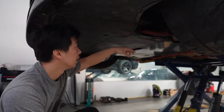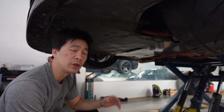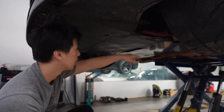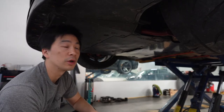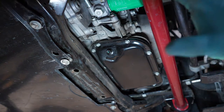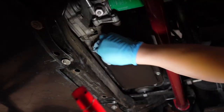Next step I do is change the oil. To do that for the GTR you have to remove the under tray — and I think most modern vehicles have an under tray you have to remove. There's a whole bunch of clips and a couple of 10mm bolts to get access to the oil drain plug and the oil filter. Now that we're under here, I take a good opportunity to look around since everything's exposed, to check if there's any leakage or anything like that. So far everything looks pretty good underneath here.